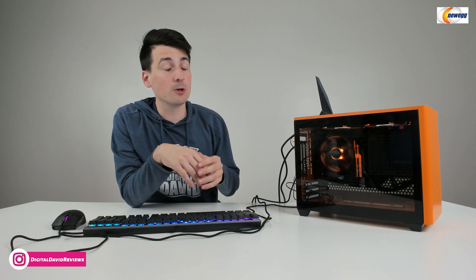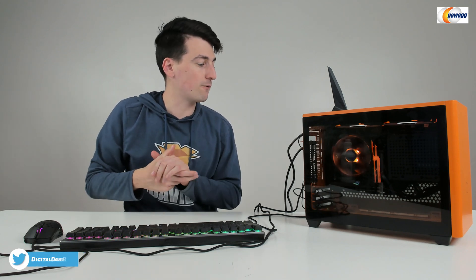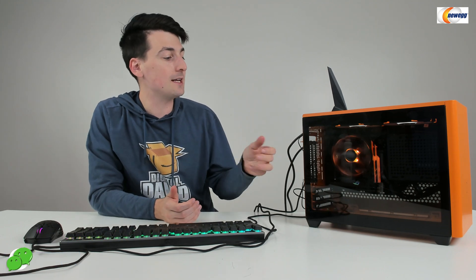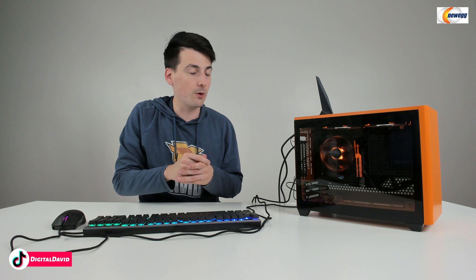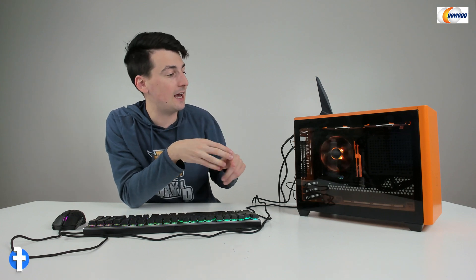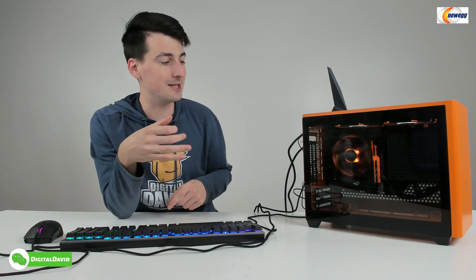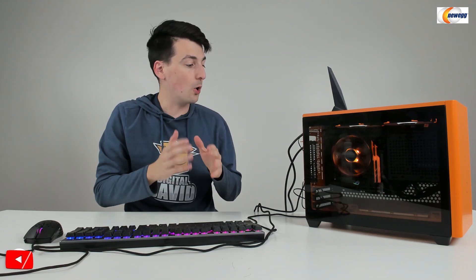Overall I've had a great experience building with this motherboard. I really enjoy ASUS products — their motherboards are fantastic and easy to use. I appreciate this motherboard having BIOS flashback; I did have to utilize that for my 5600G and updated to the most recent BIOS, and everything worked great. A couple of things I'd want to change: the HD audio header placement didn't allow for the best cable management, and I'd love to have an additional fan header on this board — I used a splitter and it was fine, but one more option would be great. But overall, very pleased — it's small and compact with USB 3.0, USB-C, and plenty of room for RGB.